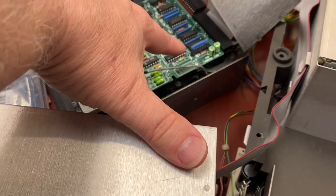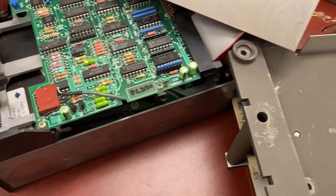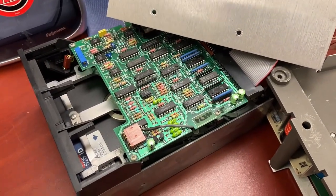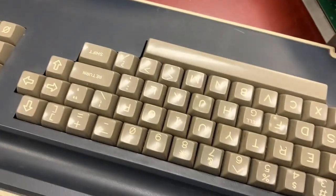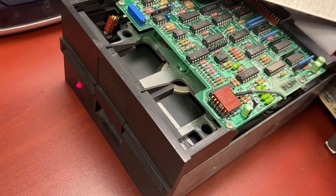To get it to identify the drive that I want it to identify as A, we're going to swap this resistor pack into the other drive. So we swapped it — it should recognize this as the first drive now, drive A, being the last one in the actual chain. Although we discovered reading the manual that there is a keyboard combination to boot off drive B, so this was probably unnecessary work. But of course, that assumes the keyboard is working all the way. We're getting boot errors.